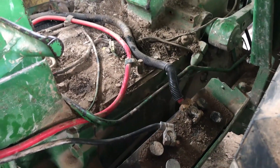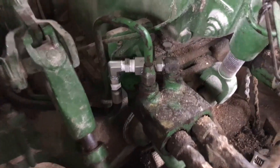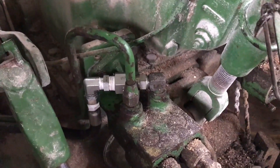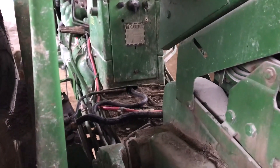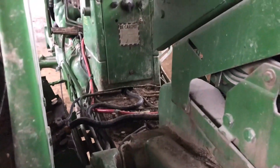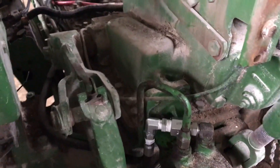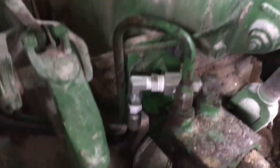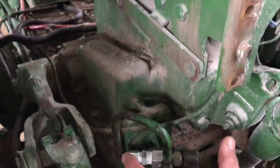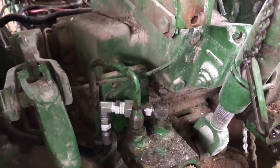You can't even get the metal lines from Deere anymore and the other one isn't quite right for this tractor. We got everything connected back here. It looks a bit rough — we had to use a 90-degree fitting to run the hydraulic hose down. The metal line I got with the tractor must have been for a power shift whereas ours is a synchro, so something wasn't quite right. We were able to make one of the steel lines work but the other one we just ran a hydraulic hose. The toolbox back here fits right over the top of this, so we had to keep everything pretty tight — it'll cover everything up pretty nicely.